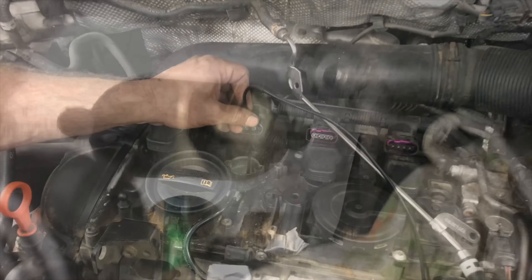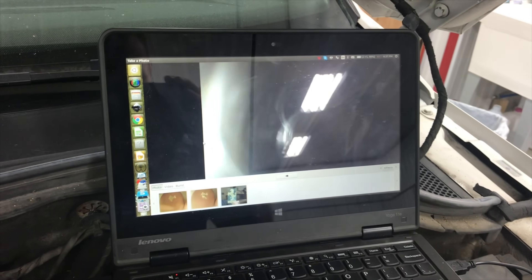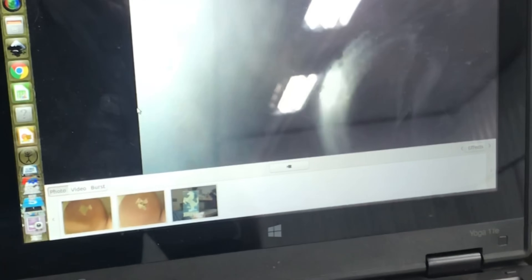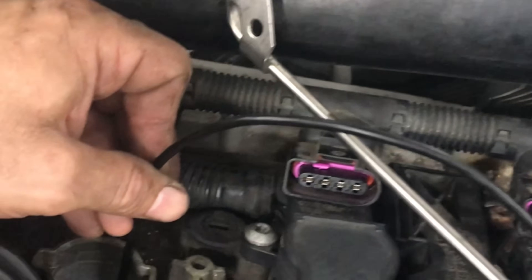About two and a half hours later they look a lot better. Just to make sure there's not too much debris in the cylinders after doing this, we'll check it out with this cheap $10 boroscope. I don't mind if there's some walnut shells in there, but I don't want a buildup that would damage the engine when we start it up. Everything looks pretty clear.